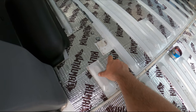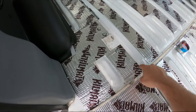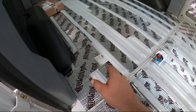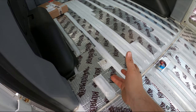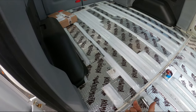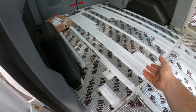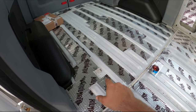I just can't stop thinking that my cabinets are going to come out to this ridge right here. This bolt right here is not far out from where I'm thinking my corner's going to be, and you don't get a more solid anchor point than that. So I'm wrestling with yanking it out and actually screwing it in from the bottom. If I decide that's how I want to secure my cabinetry on this front end, I'd be able to unscrew it from the bottom, drill a pilot hole up, drill down to it through the floor layers — and presto — rather than having to pull the whole floor back out. Food for thought if you're behind me doing this.